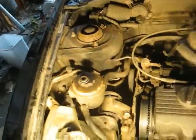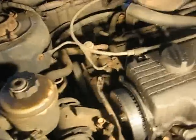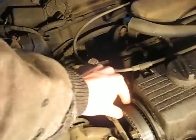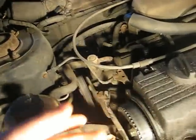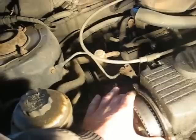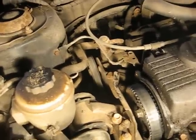We've started to take this Hyundai apart and get a good look at it. The first thing I did was take the inspection cover off, and this belt is just extremely loose. I can't pull it out, so I can't really tell if it's broken down below or if it's just the tensioner that went out and caused a whole bunch of slack in it. Either way it's not good. I'm going to have to get to it from underneath through the wheel well, taking the tire off. This is pretty much as far as I've gotten.